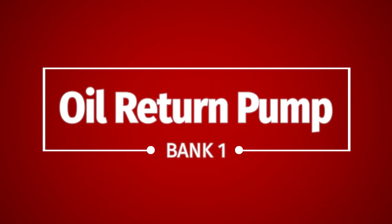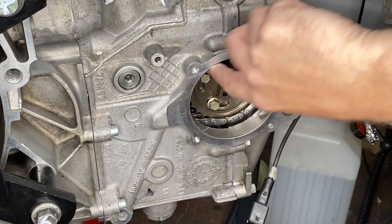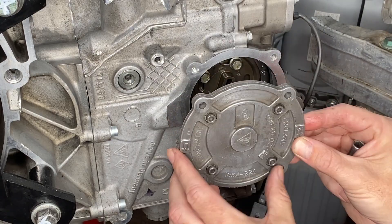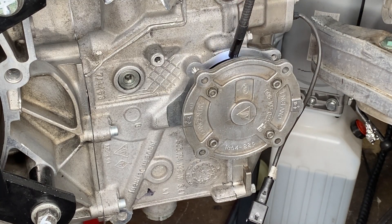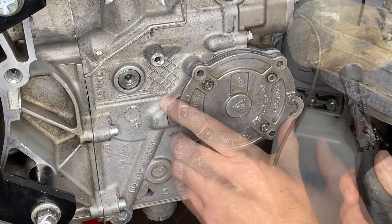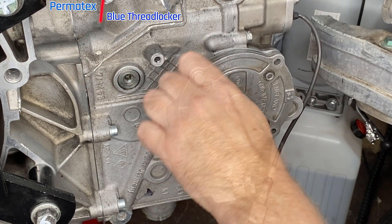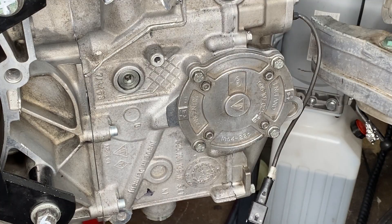The oil return pumps can go on now. For bank one, just in front of the primary chain sprocket, we're oiling them a bit because it is a very tight fit. For bank one you want the 1-3 to be pointing down on the outside edge. I'm using the borescope just to check that the drive tab on the pump is going into the slot on the primary chain sprocket, and also making sure that the arrow or pyramid points towards the inside of the engine. Then some blue thread locker on most of the bolts going back in, and 10 newton meters on those 10 mil bolts.